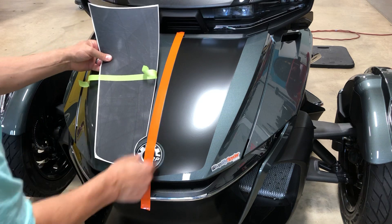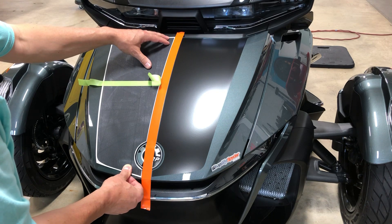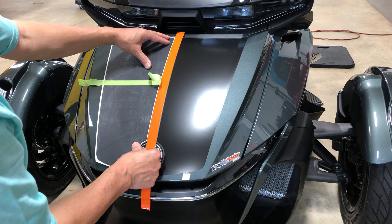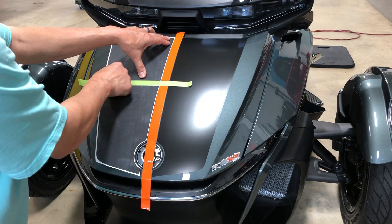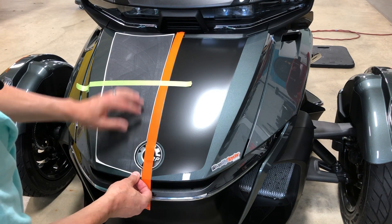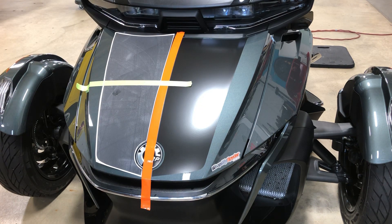Position-wise, you're going to set the graphic in place using the gap tape as your alignment. As long as the gap is the same from the top to the emblem and down below, you know you're ready to go. Do your best to keep it even with the other side and match it. Once you have it where you like it, take your tape and stick it to each side of the frunk so it goes right across and is taped in place so it can't move. This makes your installation quite easy, and you can always check your alignment across the top to make sure everything looks good.